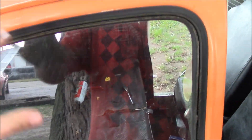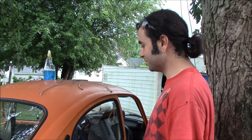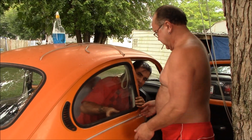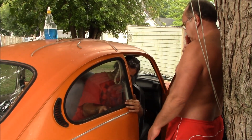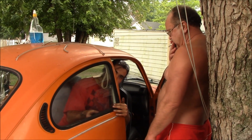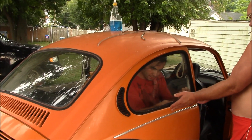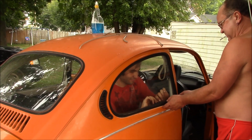That's out. Now you get the window ready to come out. I'll show you how to take it out in a second once you get somebody to hold the camera and somebody to hold the window. What you want to do is push this window out from the inside. Try to pull up the rubber around the edges — the rubber will all come out. Sometimes you can push with your feet, your hands, whatever. It's been in there since '78.